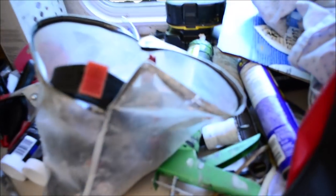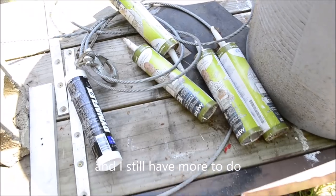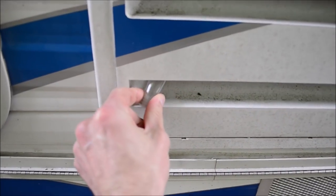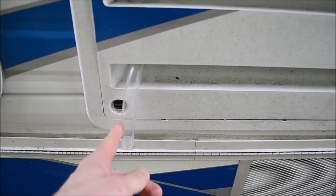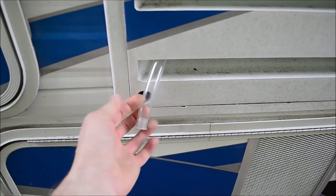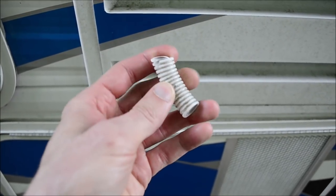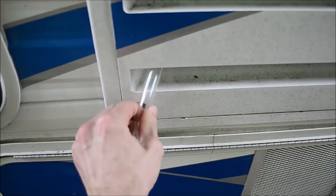So once that floor is done, that's it for the work on this camper for this year. I resealed the roof already — I used a ton of sealant, these cans are all empty. I also replaced the fridge drain and have it permanently hanging out here so that I never forget to pull it out. The old design just left it inside and you had to open it up and pull it out every single time. They also used an inferior material — this is part of the old hose, it literally just fell apart. So I replaced it with flexible PVC line.